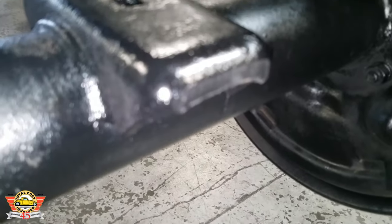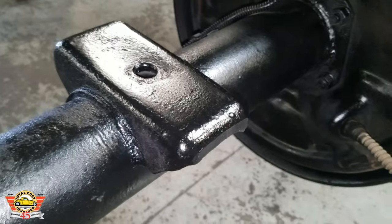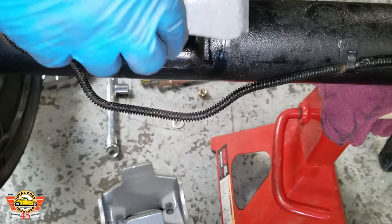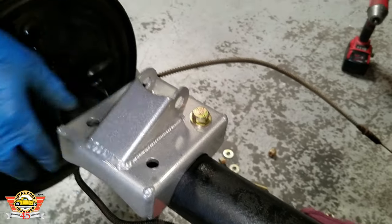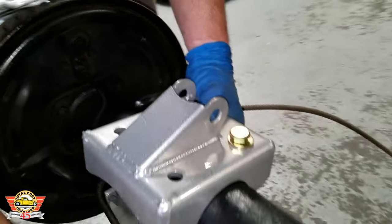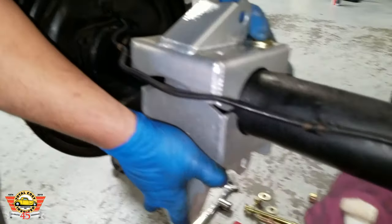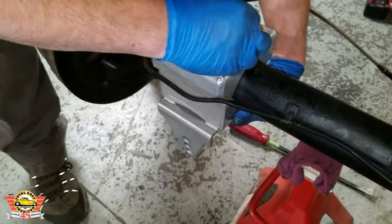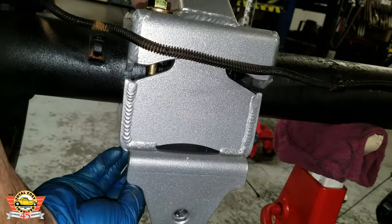We took the opportunity to put a little black paint on the rear end to clean it up. The brake hoses have been pulled out away from the housing, which makes installing the axle bracket a little bit easier. There is no left and right here — just a top and a bottom on each side. These two brackets clamp together using the leaf pad as a locating device, capturing 360 degrees of the axle bracket and leaf pad itself, so it's extremely strong.